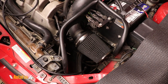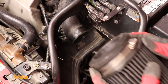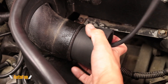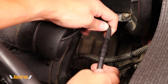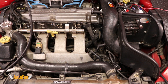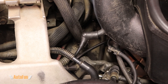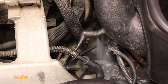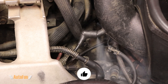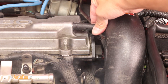For this test I'll remove the air filter to insert smoke via the intake. After loosening the clamp, I can pull the filter right off. Now I can insert the cone adapter so it's nice and tight, then connect the smoke hose to it. It's just a matter of waiting a few minutes while the machine fills the system with smoke. If there are any leaks, visible smoke will be seen coming from the area of the leak. Large leaks will show a ton of smoke, and the smoke machine can help find hidden leaks such as damaged hoses or lines.